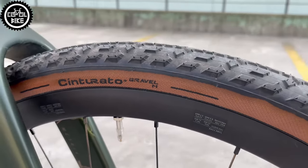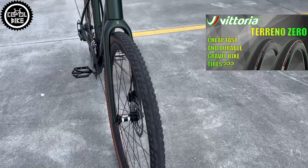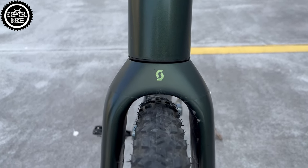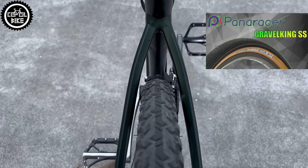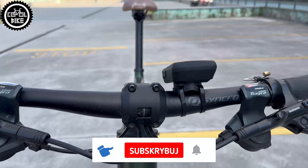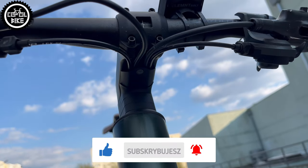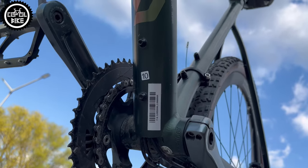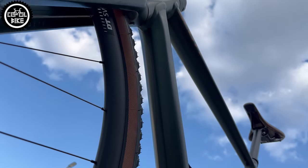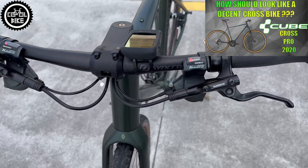Metrix is a really nice bike and a good base for modifications. The relatively cheap and solid Tiagra drivetrain is easy to convert to 1x10 and thanks to thru-axles there is a large selection of better wheels. After replacing a few weaker parts it would be hard to complain about anything else, not counting how the press-fit bottom bracket and internal cable routing will stand the test of time. But this bike has done 4000 km in rough conditions and nothing special is happening with it. In my opinion Scotts are well made and their cost has not yet skyrocketed as much as their competition, so the quality-to-cost ratio is still at a good level, which is why I can recommend the Metrix.